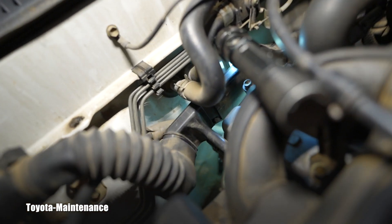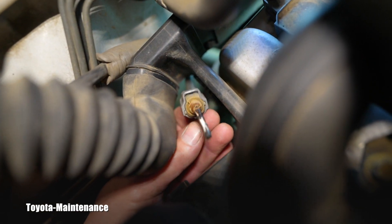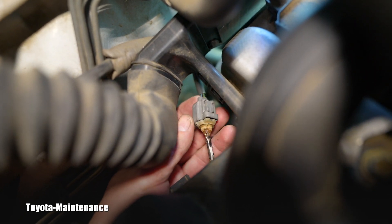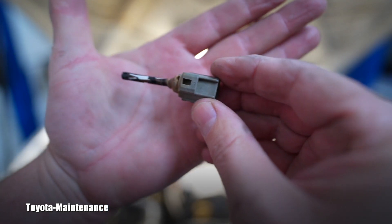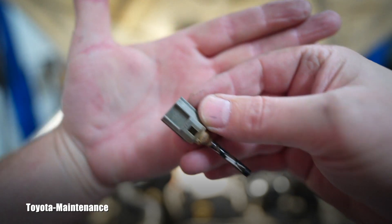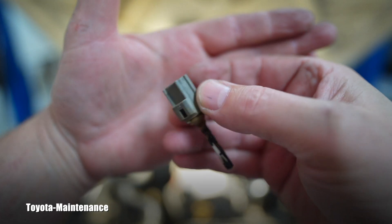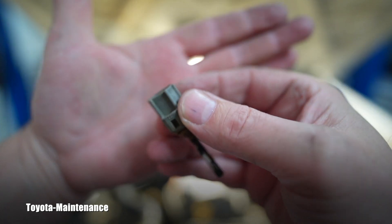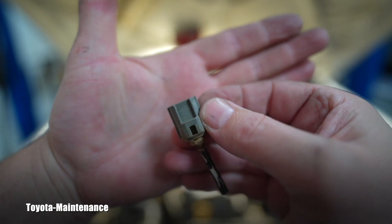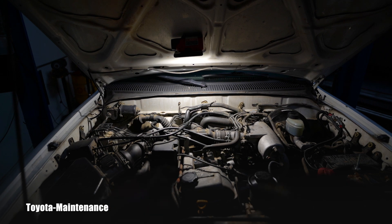While I was pulling on it, the sensor completely fell to pieces — look at it, that's the inside. It completely fell apart. This is why it was so difficult to unclip: the connector was pointing up this way, and as the sensor was screwed in with the gasket it was towards the block, making it virtually impossible to put a finger on the tab and remove the electrical connector as shown in the factory manual.